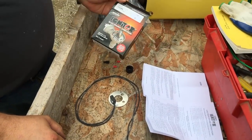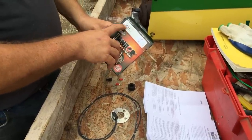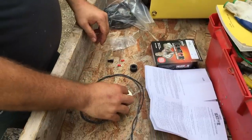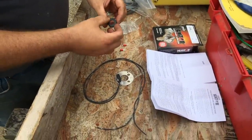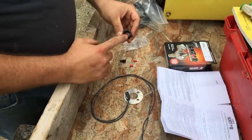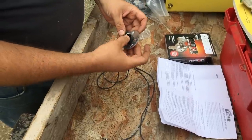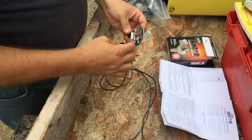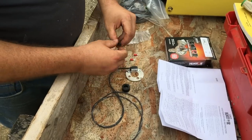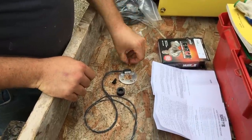Here are the components of our Pertronix electronic ignition kit. The part number for two cylinders, six-volt, positive ground is 1123P6. Inside the kit we have a small collar with magnets inside that slips over the distributor shaft — it's made so it can only be installed in one direction. We also have the actual module: as this magnet with the rotor spins, it picks up the magnet position and tells the module when to send fire to the individual cylinders. There's also a pigtail grommet and a couple of loop-type terminals.